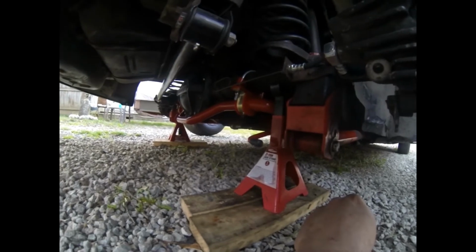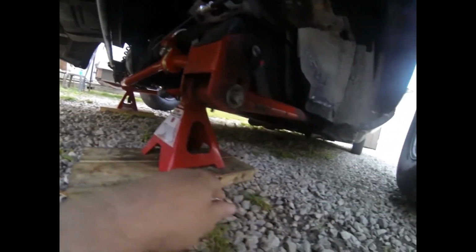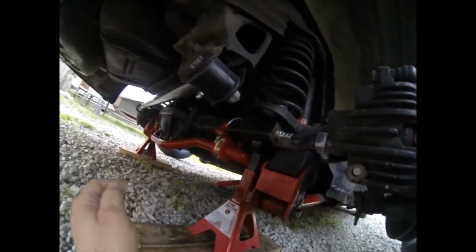I'm going to get down here with the grease gun and start greasing all these fittings because they need it. There's two on the lower control arm. There's two on the sway bar. There's one on the panhard bar. And then I think there's one on the front. No, there ain't one on the front of the torque arm. There might be on that bottom one. I'll get up there and check. But then there's the front ones on the top and bottom ball joints on the front of the car. I need to do those too, but that's what we got.